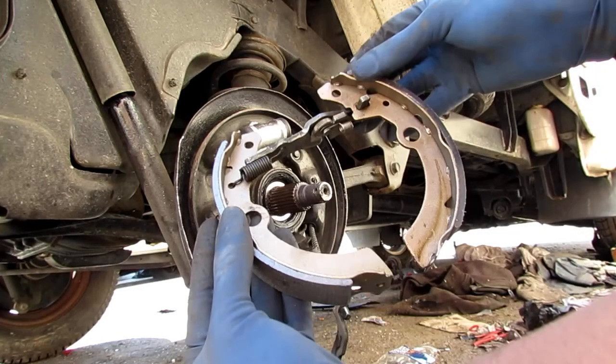So at this stage of the story of my life, things get really interesting for multiple reasons. For one, I'm unaware that these new brake shoes are thicker. They're too thick. They're out of spec, so they will not fit. You can see later on I struggle. But then after I struggle trying to put the brake drum on, I just forget it, and I was just like, let me just finish the video so you can see how the process would go from thought to finish.